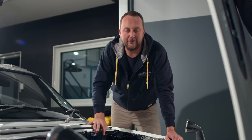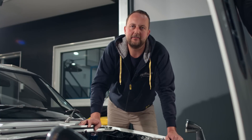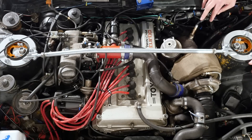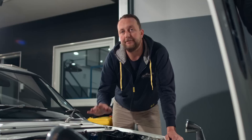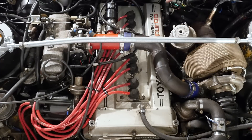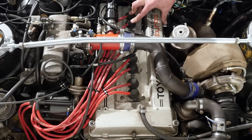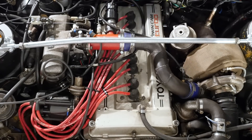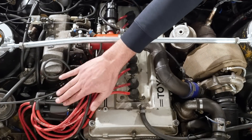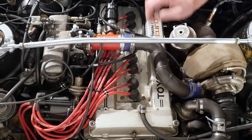As we lift the hood and take a look at the engine bay of this Toyota Celica, you're going to see a whole bunch of stuff that you could have only dreamed about if you were building a car in the early 90s. Starting off with the engine, this thing's got a 3T engine — factory it had the 2T, the 1.6 litre. This is the 1.8 litre engine that did come with a factory turbocharged option. The first thing you're going to notice is it's got eight spark plug leads. It is a four cylinder engine — it's actually got two spark plugs per cylinder. It's a distributed style ignition with a factory coil setup, so it's actually got two coils. They fire into our distributor cap, then that spark energy comes out to either the primary or the secondary spark plug on each individual cylinder.